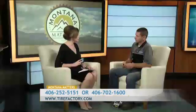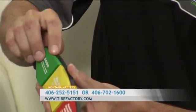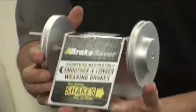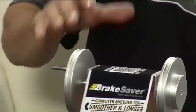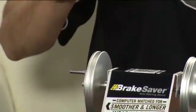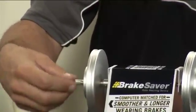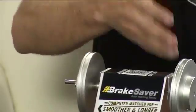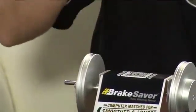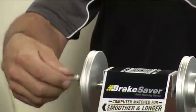So how to tell if your rotors are warped, and how do you fix them? We'll start with the brake pads — this is a brake pad thickness indicator. The green is obviously new. By the time it gets down to the red, it's down to 2 millimeters of thickness, which indicates the pads are time to replace. As far as rotors go, this is what a new rotor looks like when it's spinning — nice and true and straight. A lot of times customers come in saying their car shakes when they slow down or they feel a pulsation in the brake pedal. That's actually caused by a warped rotor — you can see how the one on the left wobbles. That's caused by excessive heat buildup or shock cooling. For example, if you're slowing down and the brake rotor gets hot and you go through a puddle of water, that shock cooling can cause the rotor to warp, and that pulsation is transferred up through the brake pedal. That can be fixed by either putting the rotor on a lathe and machining it back true again, or if it's too excessive, they have to be replaced.